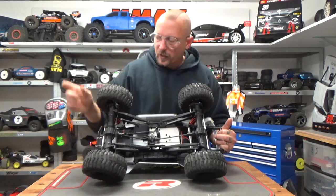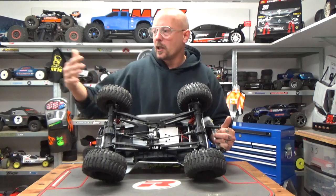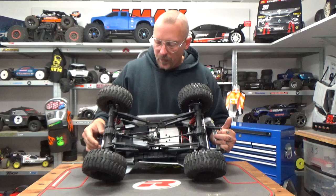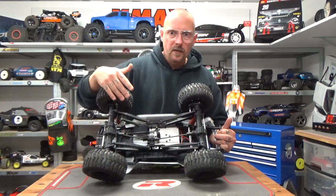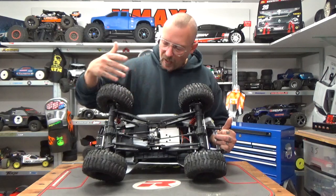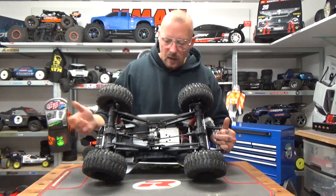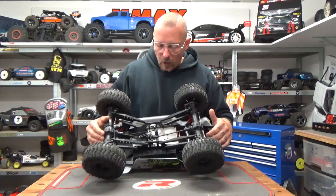The old one was only 62mm long and did not have enough torque to push the car to its maximum speed. It reached with the old motor about 50, maybe 52 km an hour. On mine I put a 74mm motor, and have a speed up to 60 kilometers an hour with less heat and a longer runtime. Here we have a stock motor. I hope it's way better.